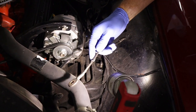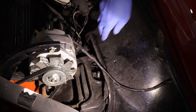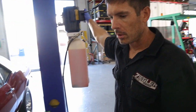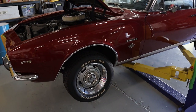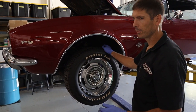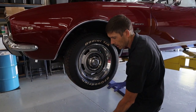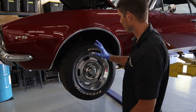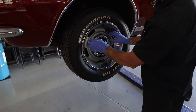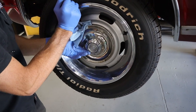Now that we've got it cleared out, we'll do the same on the other side — take the shock out. I'm going to lift the car up to working height on the rack. It's going to be the same as doing it on the ground, just working up here instead of down there. Now we'll take both tires off and get them out of the way. I gotta be careful with these caps — I don't want to scratch the wheels, so use a towel or something to protect them.